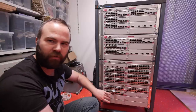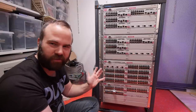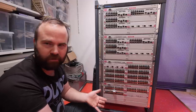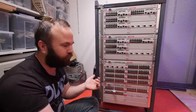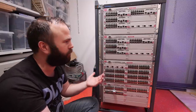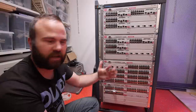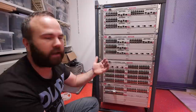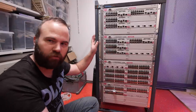The nice thing is I now almost have all the modules available for this system. I only don't have the 12-port FX 100 megabit fiber option — but that's also the least interesting blade. And I don't have the 10 gigabit blades because they're super hard to find or super expensive, so I'll search for them on eBay if I can get them cheap. For now we'll just use 4 gigabit trunks between the switches, which will probably be more than enough with 10/100 clients, plus a VLAN for modern machines for streaming. This will be a super powerful network.